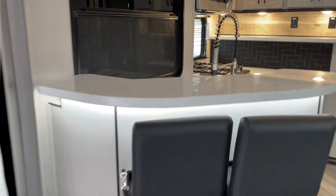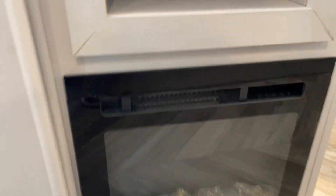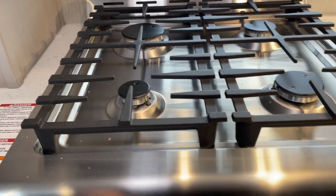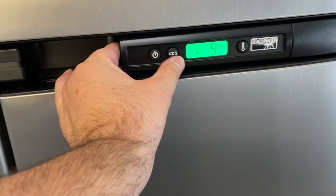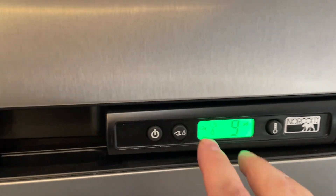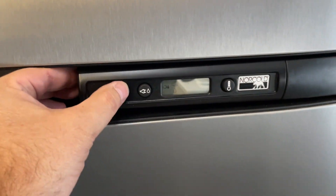We always locate your keys around your kitchen faucet, just so you know. Your fireplace is right down here — simple power controls at the very bottom turn it on, and you can adjust the flame. That is a carbon monoxide detector there. When you want to operate your gas, it is auto ignition — simply turn that and hold it in, gas will come forward, and that will automatically ignite. Fan switch controls there and additional fan controls there. Automatic refrigerator here — simply push that to turn it on and it'll go to the most convenient power source. Droplets mean gas, the plug icon is for electric. If you want to go to whichever is most convenient and available, push it again and that'll indicate it's now operating off gas. Leave the desired temperature at nine — it's always a good place for it — and that right button controls your temperature.